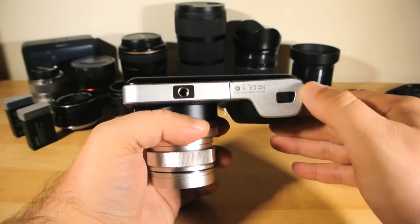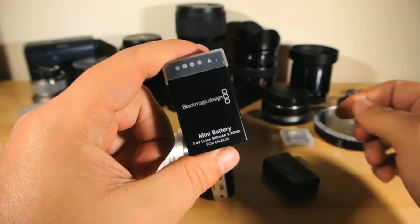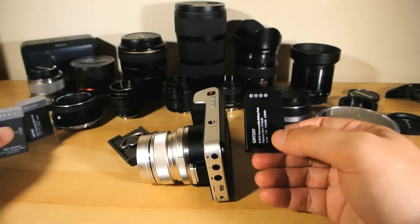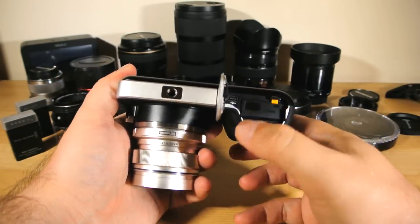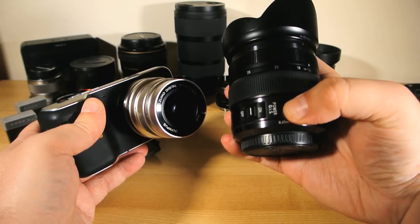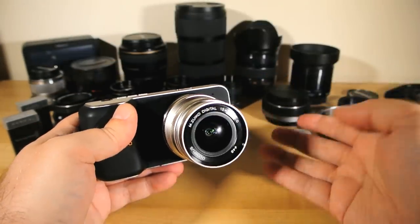And while we're down here, a note on battery life. It uses a Nikon-type EN-EL20 battery, and the one that comes with the camera is just 800 mAh. I've also been testing with a pair of aftermarket 900 mAh versions, which cost me about $12 each. There are even higher capacity versions available, and you will be wanting extra batteries. With a standard micro four-thirds lens with no stabilization, you'll get just short of an hour of run and record time. With a stabilized lens, which uses more power, you'll get closer to 30 or 40 minutes. And with a completely manual lens that doesn't use any power at all, you'll get just over an hour or so. This time can also vary depending on temperature.